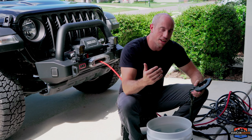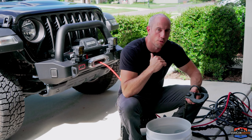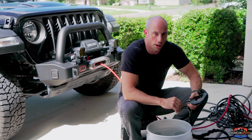We got the winch line all spooled out — I hope you were able to see just how much filth and dirt came out of that line just from unspooling it. We left a couple wraps on the drum, which will allow us to re-spool this properly and make sure we have a firm, tight grip on that drum when we do it under pressure.